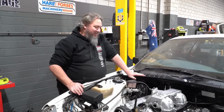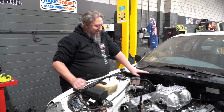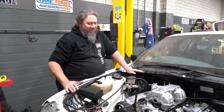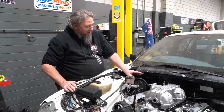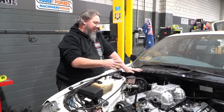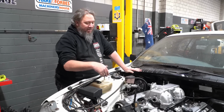So we're going to have to yank the motor again at some point and probably go to the VS booster, which everyone tells me is smaller than this VR style steel booster. So we'll have to go to the VS plastic booster, which apparently sits a little bit further back and is a bit smaller. Would that have cleared the cam cover?